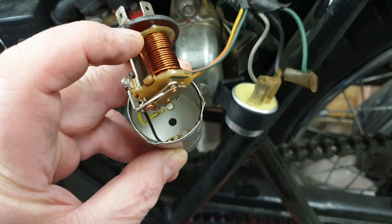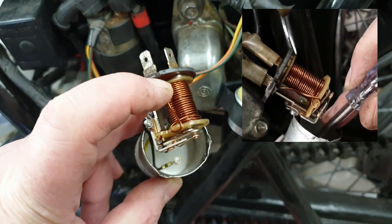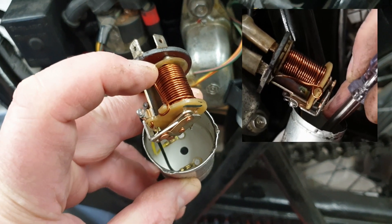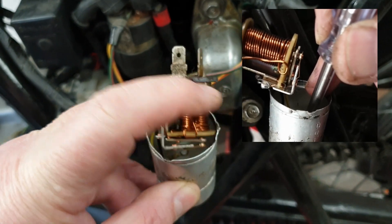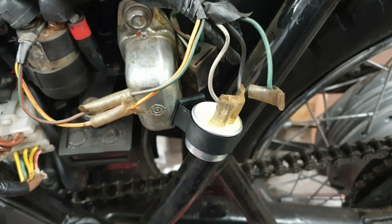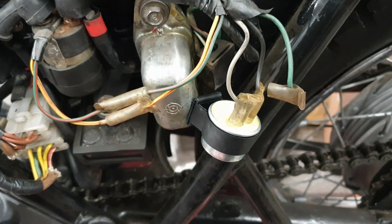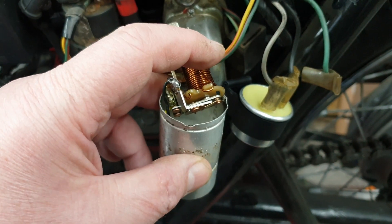I think I've got most of the connections sorted in here now. I'm going to have a look at the indicator relay, indicator warning light, and then move on to the horn. Not quite sure why the indicator relay is not working — it's something to do with a bit at the bottom which I think is the delay on when this magnetic switch goes. However, the new one, which is much smaller and obviously solid state, works a treat. It's a shame it just doesn't look quite original.